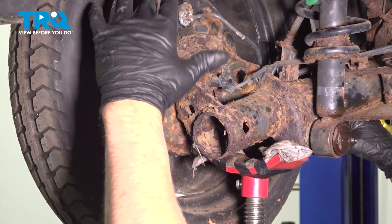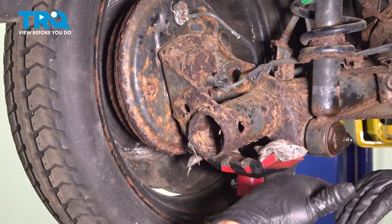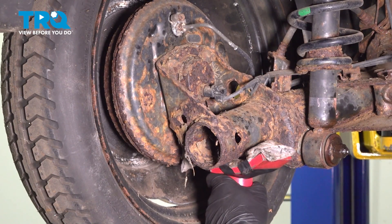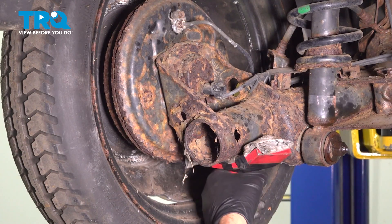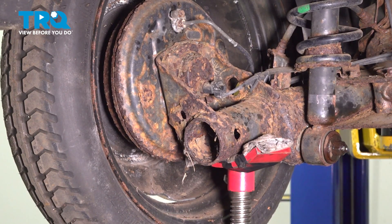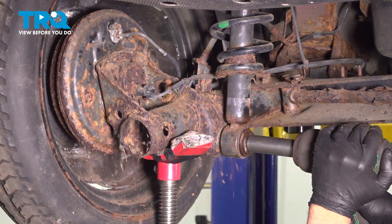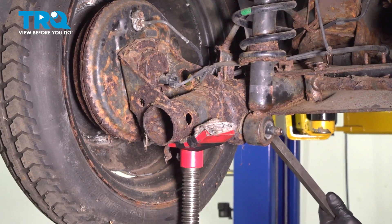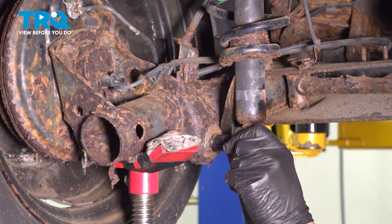Underneath the vehicle, you want the tire hanging because we are going to pull the spring and shock out, and you don't want the vehicle to collapse on itself. With the rear wheels hanging, I'm going to put a floor jack underneath here just to support it, because when I pull this out it could fall a little bit — at least have it supported, but don't have the weight of the vehicle on the wheels. Using a 19-millimeter socket, take this nut off. Take that washer off. Just using a pry bar, pry this off, just at least so that it's loose.